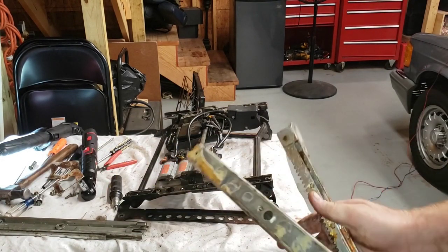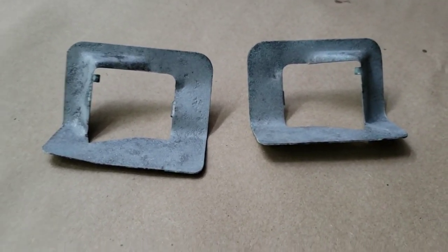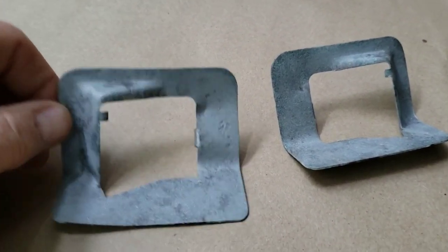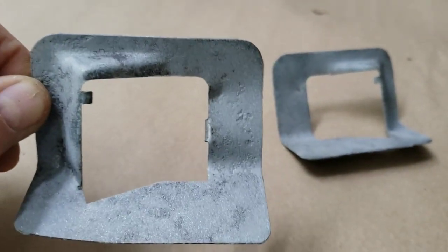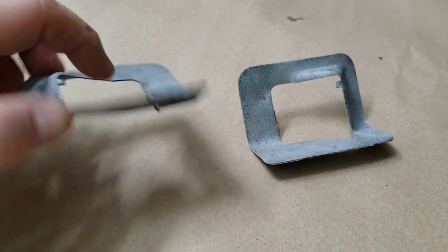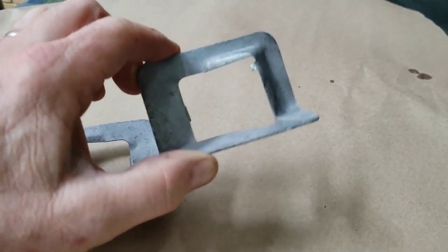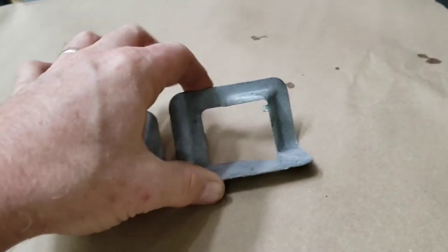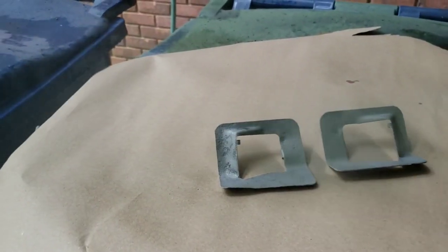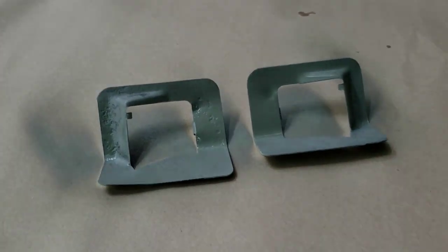That's about all for tonight, so I'm going to clean these up tomorrow. Got this second set of little covers here for the driver's seat that go down around the back feet. You can tell these were corroded pretty badly and I had to break out some much more aggressive media blasting stuff — it's called Black Beauty. It's much more granular, a lot rougher texture, and I was able to get that rust off. We're going to go ahead and prime these with some self-etching primer and then get a coat of cast aluminum gray on them.